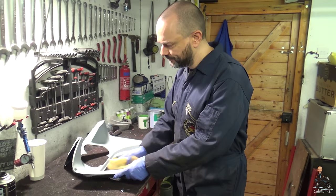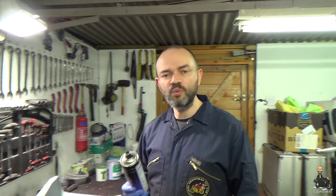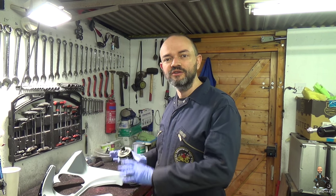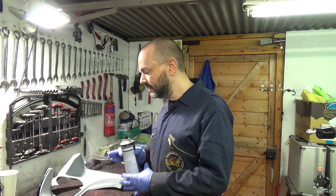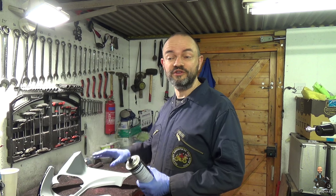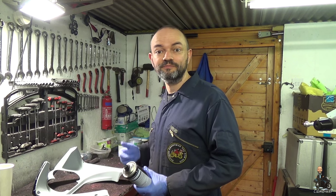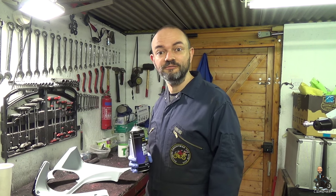So, what we're going to do with this, before we get on to the nice paint, weirdly, we are going to use a bit of rattle can. All we're going to do is put a really light mist coat over the whole thing. It'll change the colour a bit, but it's not covered. And then we're going to sand that back. The idea is that once all the black's gone, we know we've sanded every last part of this piece. We know it's all keyed and smooth, and it's ready for the proper paint to go on. And hopefully we won't get any reactions because this will be gone.